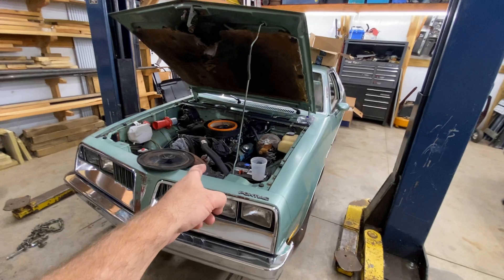Bill and I decided to do a little side trip because he pointed out I don't have the right pulleys. You've gotta have a three-groove pulley on the bottom. Looking at our example vehicle — this is power steering, alternator, and air conditioning. I don't have air conditioning, but you see the front belt on the power steering goes to the front groove on the front pulley, the alternator is on the second groove, and the air conditioning is on the third. I don't need the third one, but I need that three-groove pulley on the water pump and on the bottom. And we've got them — thanks to Bill's local contact Chris for the pulleys. We'll replace them for him at some point. We're in good shape there.